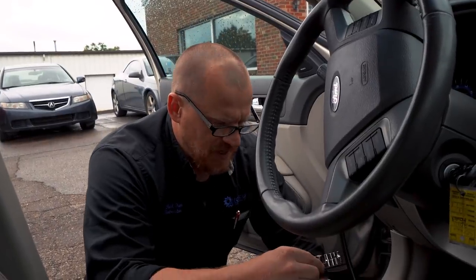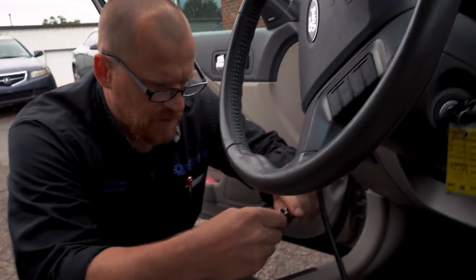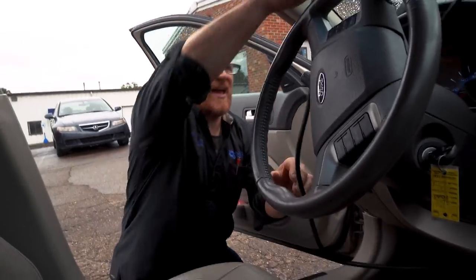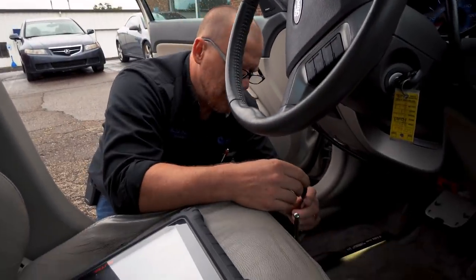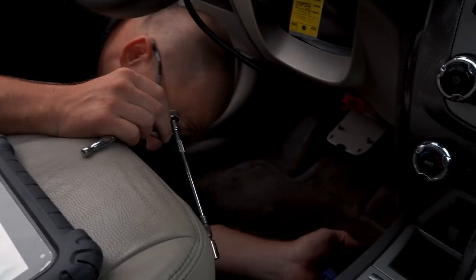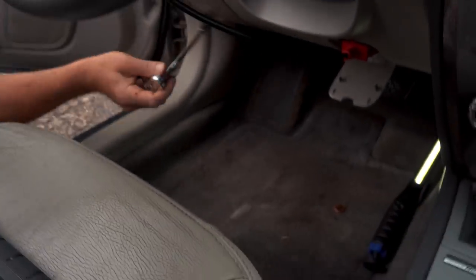Yeah, what a goofy design with that tethered piece in there, man. Air still nice and cold. I'd imagine on a real hot, humid day like today, evap core icing is not a problem. It's gonna be when it's 60 degrees, 65 degrees, you're using defrost and the air is cold to begin with. I think that's really when you're gonna have issues with icing.